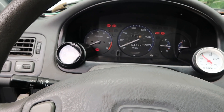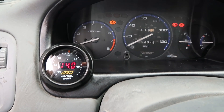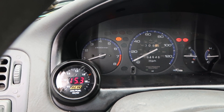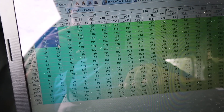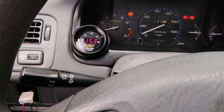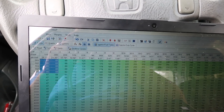Let me go ahead and fire it up. It's a little lean but it's pretty close. I'm going to throw some fuel in there right now. This is pretty much where it idles out. I'm going to add 1% fuel and see what that does. She wanted 1% more fuel at idle to be closer to 14.7 AFR. It's as easy as that — just ground, five volt reference, signal wire, and then go to plugins in Chrome and do the conversion to the GM three bar. If you liked the video, please like and subscribe. I'll see you on the next one, thanks for watching.